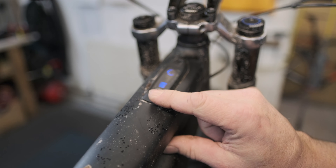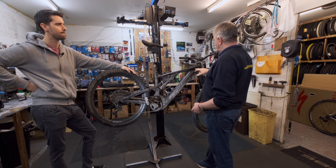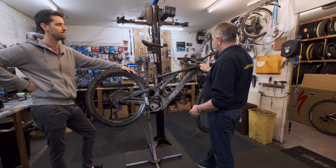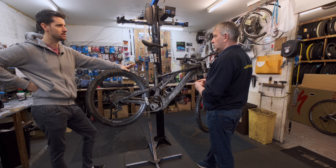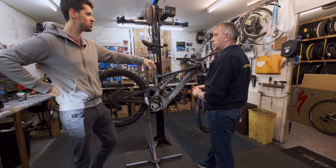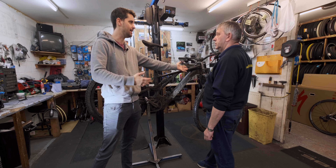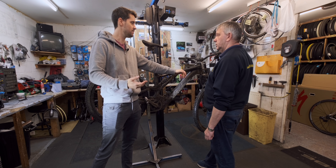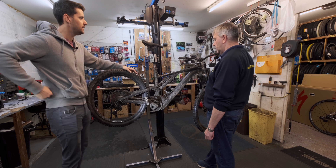We seem to have five steps forward and then a couple of steps back. The TCU is so much better for the rider — you can see everything, what mode you're in, how your battery is — but where the cables go it's not fully sealed, so you're going to get water in there. That's what happened to mine. I've had a replacement TCU on this one, and I have washed it a lot — water did get into that part.